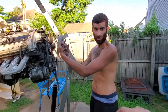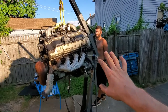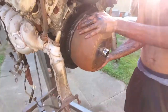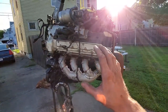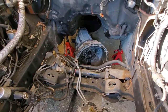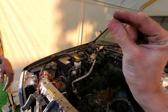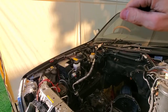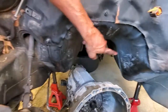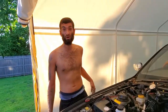We got it out — and this thing is not going back in. The VG is so easy to take out of our car compared to this. Since it's an automatic, the torque converter was just ridiculous to deal with — the motor's seized so you literally can't spin it to get the bolts. It was insane. We were tilting the motor up, tilting it down, tilting the tranny up and down, inch by inch, until finally we got like a centimeter and pried it off. The tranny hit the ground and we were like — see ya.